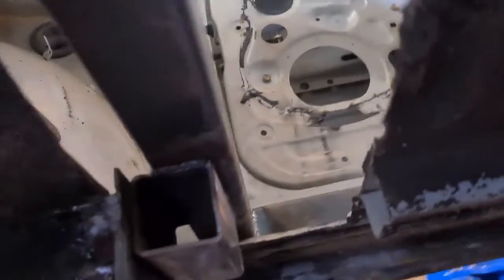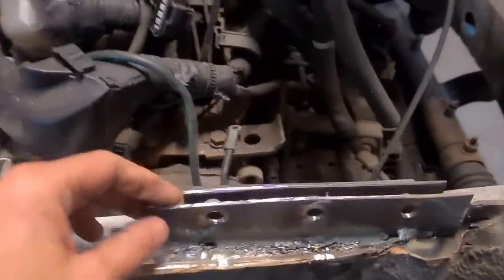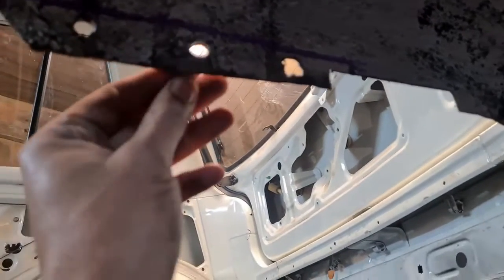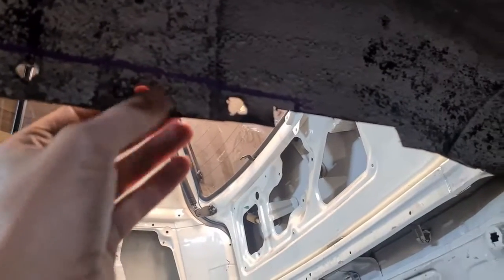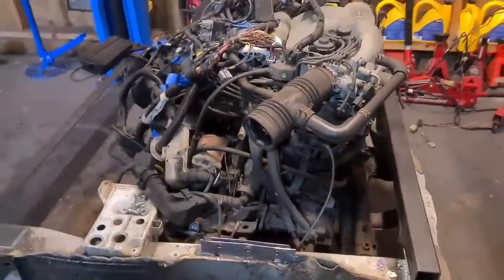And so that's our sort of inside support, and I'll show you more of that once I drop the body down. Meanwhile, what else I've done is made up this little bracket here on the Camry chassis that sort of pinches the wheel arch here, and that is 2 bits of sheet steel spot welded together, so it's reasonably thick. And I have tried it with just those 6 bolts, 3 on each side, and just that alone will lift the Camry chassis up and hold it in place.